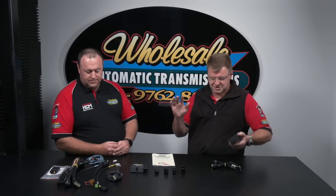There are two sets of looms here. For anybody starting fresh who doesn't have a lock-up in their car at all, you get a complete master kit. So the main kit here is the full kit — you're going to get your main harness, various bits and pieces including switches, and a CAN bus connection if you have a CAN bus vehicle, or an analogue harness if it's an analogue vehicle. You only get the one that you need, a specific configuration depending on your vehicle. Everyone gets the module, which is the brains of everything. And then we've got different switches depending on your vehicle configuration.